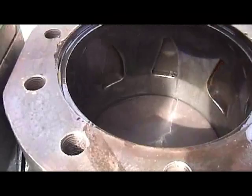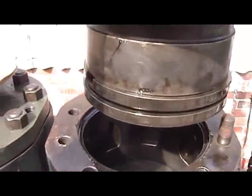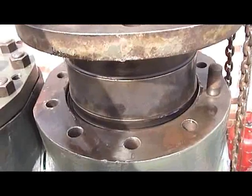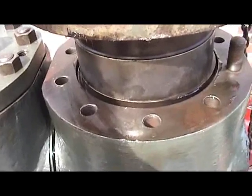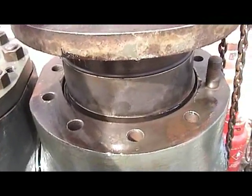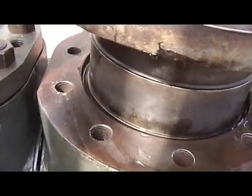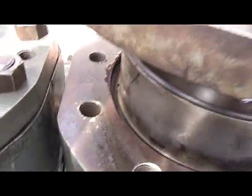As you can see the piston is on top dead center but quite a long way down. So we'll now fit the cylinder head. The first ring has now entered the sleeve and we'll now enter the second one. The second ring is now in the sleeve and you can see the gap in the foot faces.